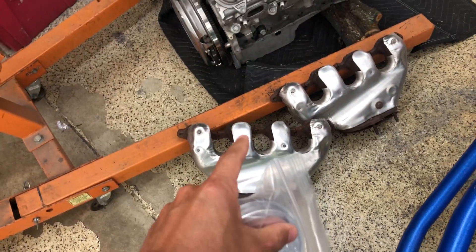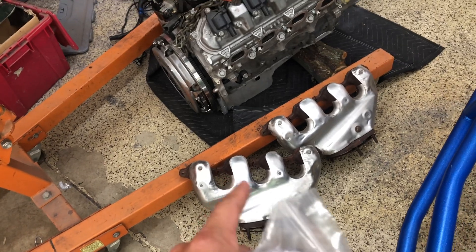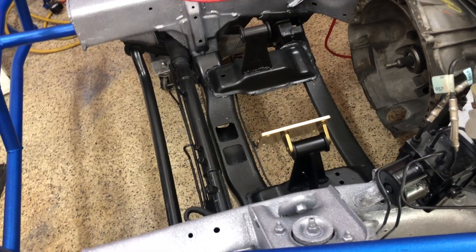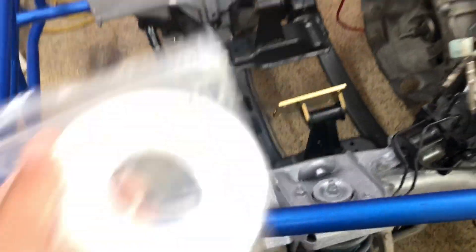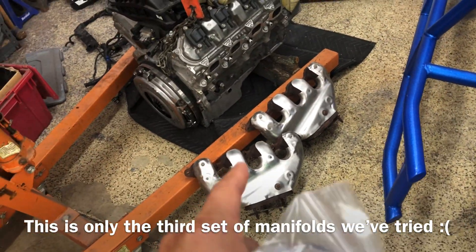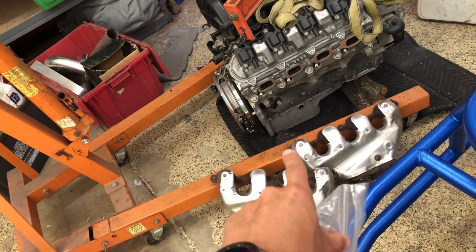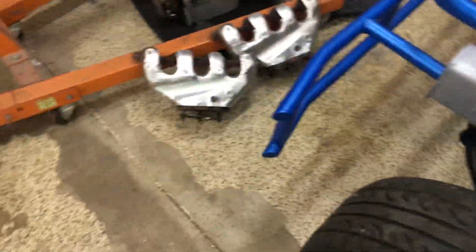We also picked up a set of LT1 headers from a Corvette - well, exhaust manifolds. Picked these up on eBay and got a pretty good deal on them. I did some mock-up just holding it in the air and I don't have high confidence they're going to work. There's just not much clearance between the motor mount and the frame, and these are pretty wide. Another option is the Holley swap manifold - it's cast iron, about $300. Their outlet is kind of straight down at the back of the motor, which for us would be pretty much perfect since we have a lot of room there. If not, these will be up for sale soon.